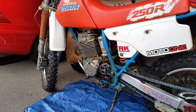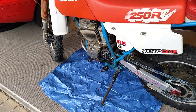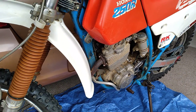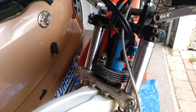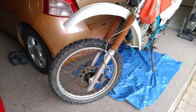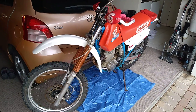Just checking all the nuts and bolts — axles, axle nuts, seat bolts, around the tank. I also check things like the levers — gear lever, brake lever bolts — even making sure the manifold bolts are all nice and tight. Come around the front here, check all the triple tree bolts, these are all 12mm, check they're all nipped up nice and tight. Nothing was loose. Down here on the 10mm bolts, check all those are okay on the axle.